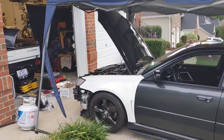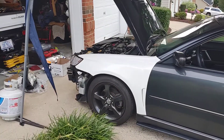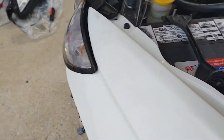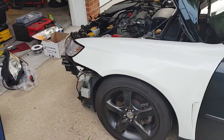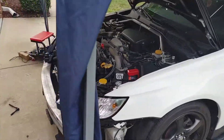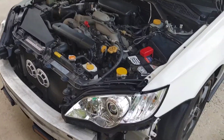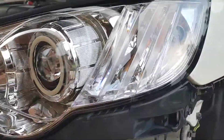I kind of did a lot since the last time I recorded, so I missed some of the process. Since then, we've gotten the fenders on — had to do some shaving. I shaved it back; it's not a perfect fit, but I'm going to try and get the body shop to help fit it. They look pretty good. Since then, we got the Vivid Optics Retrofit headlights in. For the head connections, we tapped into mainly the turn signal and stuff to get the halo going since I had a switchback.